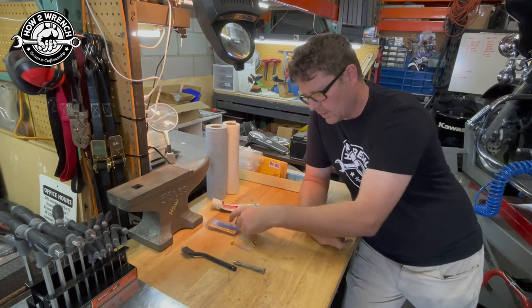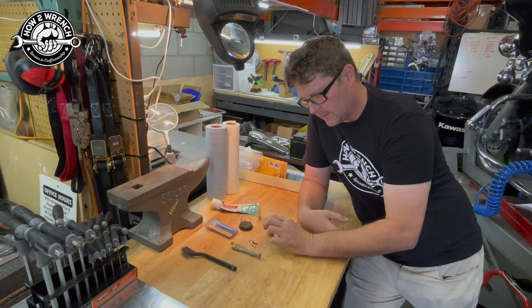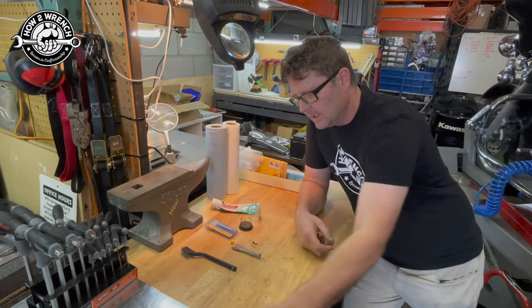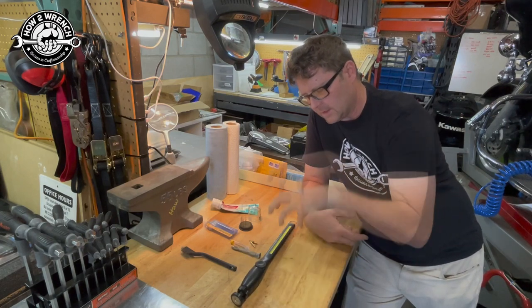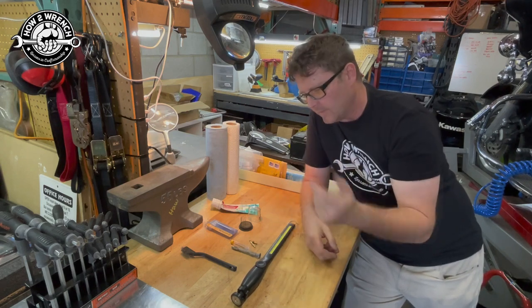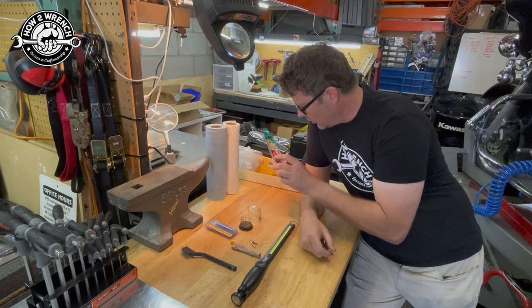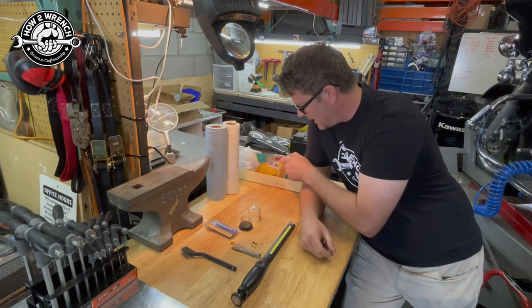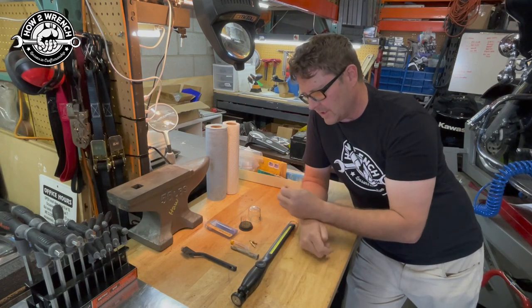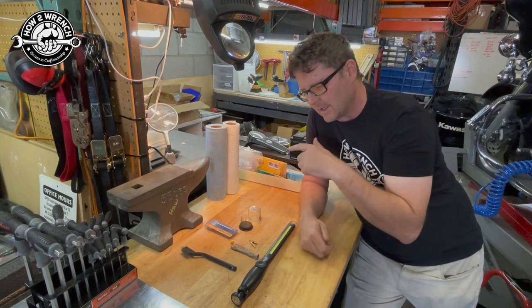I'll put the links below — they had a bunch of other sizes as well, and a link to the whole stand if you don't have one. That is a fantastic way to not only get the jets started and clean, but use it alongside your other resources like carb cleaner and ultrasonics. If you've never used light in your camera to actually verify and check if you hurt the jet or if it's clear before putting the carb back together — that's a great way to validate it. Toothpaste is only for cleaning needles and seats, just so you know. Please join the channel — best two bucks a month you'll ever spend. Like, share, subscribe, make it a great day, and keep wrenching!